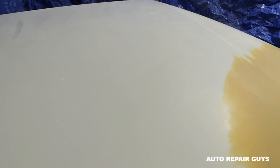Now, whether you're repainting your old hood or a new hood, what you have to do is wet sand it with 600-grit sandpaper. You must have no shiny spots — you can see that spot right there is wet right now, but there should be no paint shine, so the new paint will stick. Dip the 600 sandpaper in water and sand. We have a video on our channel on how to prepare a surface for paint.